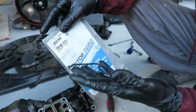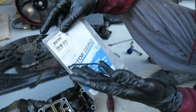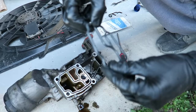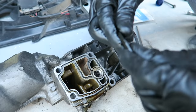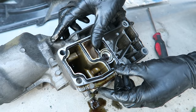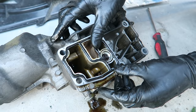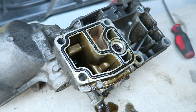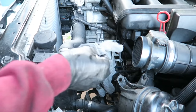You can get this gasket at CarQuest or anywhere — it's like four dollars. The part number is B32 350; it's a Victor Reinz gasket and I've had pretty good success with all of them. If you want, put a little bit of oil on the gasket by dipping it in oil. Then go ahead and get it on there, making sure you push it in all the way especially around the grooves where it's supposed to hold it, so it doesn't tear while you're putting it on. Make sure the mating surface is clean on the housing and also the block, and then you're ready to put it on.